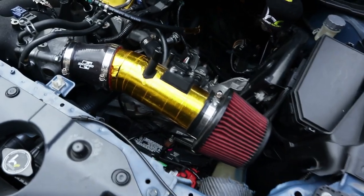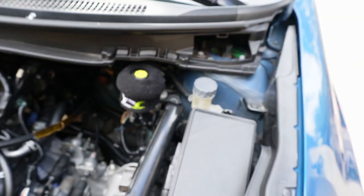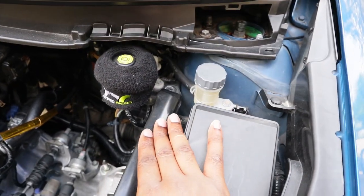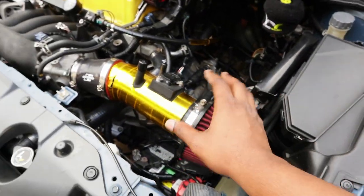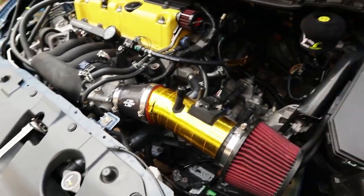Car's up in the air. Now I'm gonna show you what to do to actually get to your mount because it's hiding. There's gonna be a 10 millimeter bolt right here holding up your ECU — you're gonna want to unbolt that. Once you do, if you have an intake like mine, just loosen it up and place it to the side. If you have a stock box, remove your stock box.